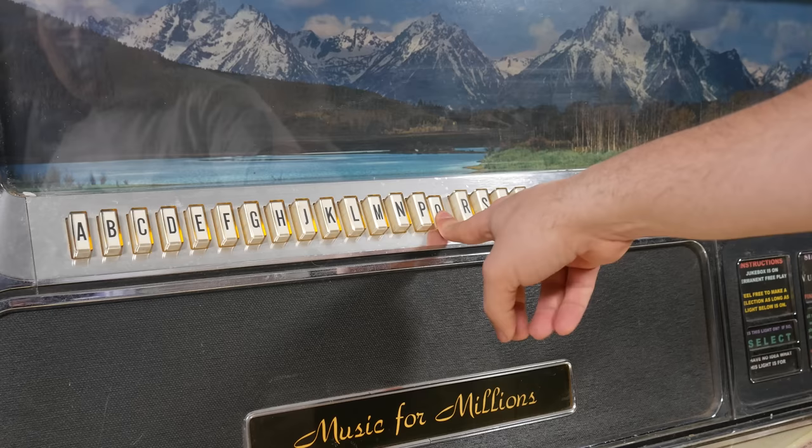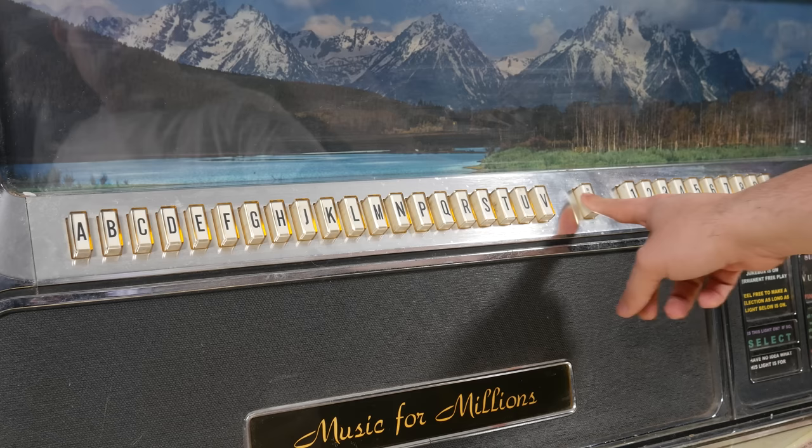The reset button is simply a momentary switch that will interrupt power to the solenoid. That will cause it to let go, and a spring will pull the linkage in the other direction to release the erroneously pressed button. Here's what that sounds like.